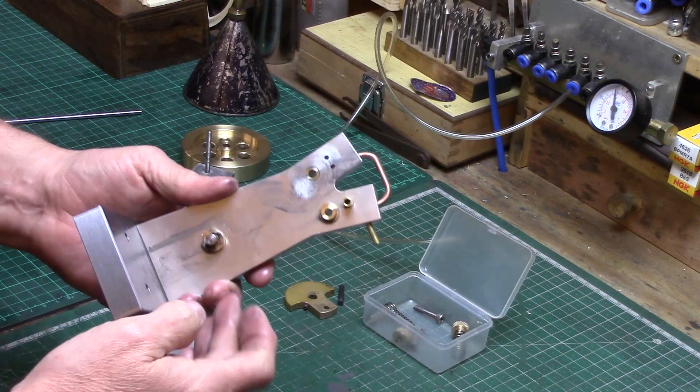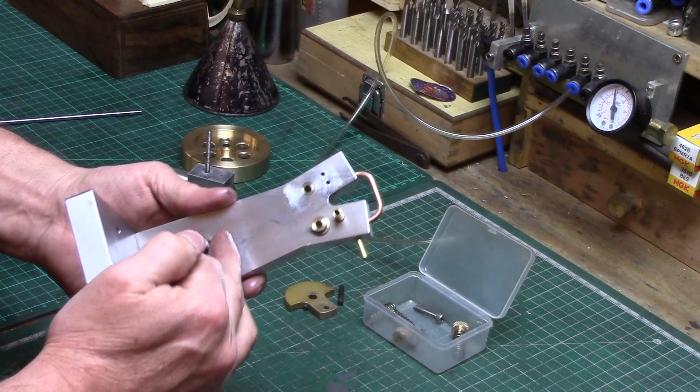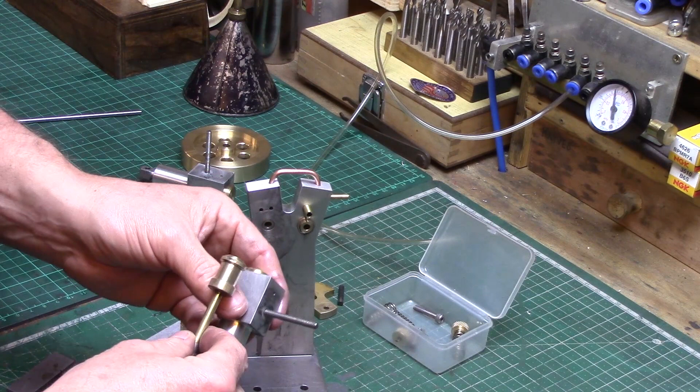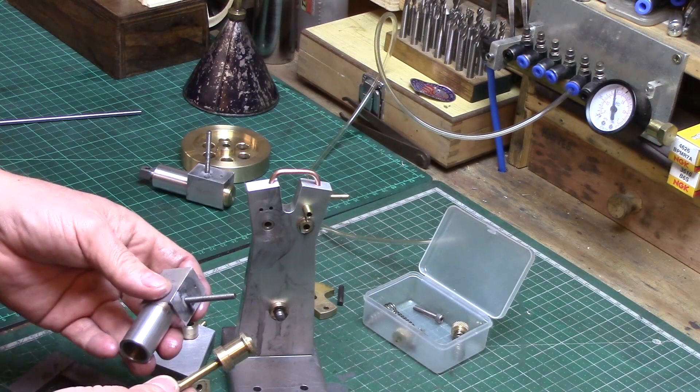But what I must have already done is already taken the three millimeters off in my head, and then took another three off. So I ended up three millimeters down. And of course that - not only giving me all the trouble with the pistons coming up three millimeters higher into the cylinder covering the porthole - air locking.